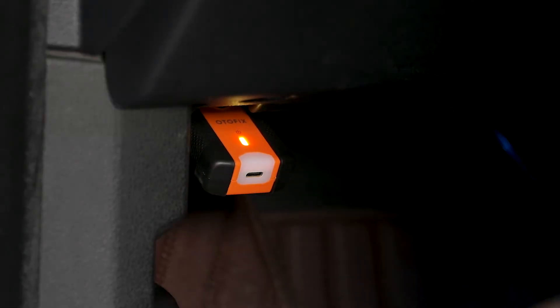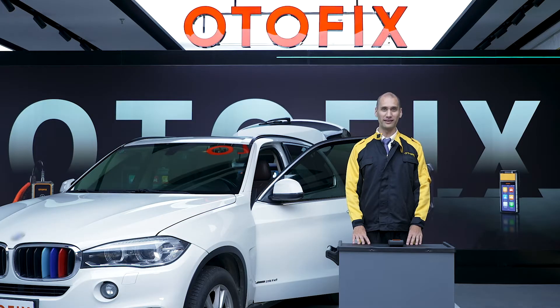You'll need to plug in the V1 VCI into the vehicle's OBD2 port underneath the steering column. Connect the V1 with the BT1. A green check mark will appear in the top right corner on the VCI icon. Open battery reset on your BT1.